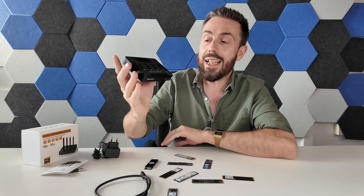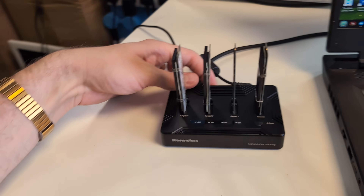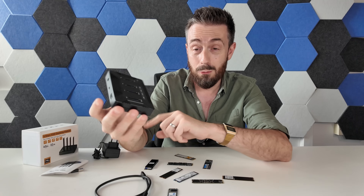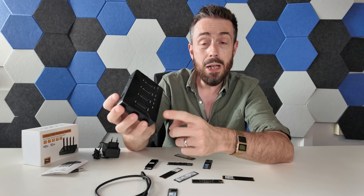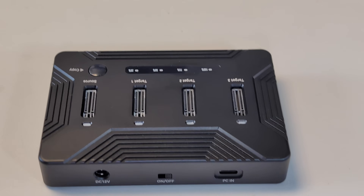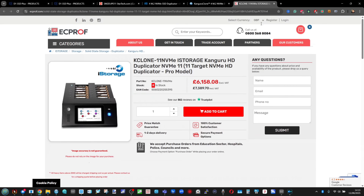This is affordable for a reason - it is not to be confused with a forensic level duplicator. Things like secure erase wipe and write blocking, where you want to make sure the original source disk is 100% confirmed to never be writable, are absent. There's no option to run a forensic level scan or dupe - just the simple operation - which means for forensic level evidence and cybersecurity use, this would get laughed out of the room. Those kinds of duplicators start at $500 to $1,000 for M.2 NVMe level duplication just to enter.